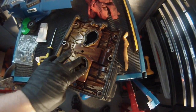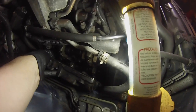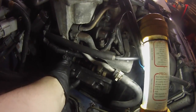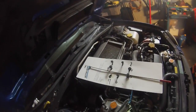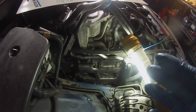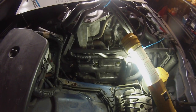Place in the spark plug gaskets. When you lower this down, take a good look and make sure that those bolts on the bottom here clear. Remember we're putting each bolt back into its spot so all the sleeves are there. Once you get them back in, go around in a star pattern and only do about five or six foot pounds — not too crazy, but get them on there decent.